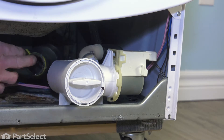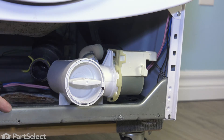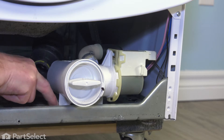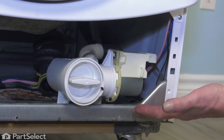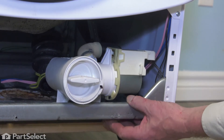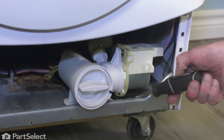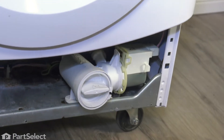Now, once we've released that hose, we next need to lift the pump away from the base frame. It's supported by a rubber mount on the left-hand side towards the center, and then another one on the right-hand side. That one will need to lift up on the rubber tab as it's jammed down into an opening in the base frame to hold it in place. Now, we have room to reach in underneath and push that rubber mount up through the opening. If not, you can take a flat blade screwdriver and come in from the top and just pry it out of that opening, and we'll slide the pump to the right.